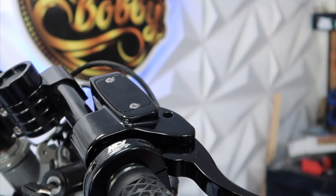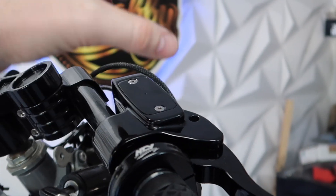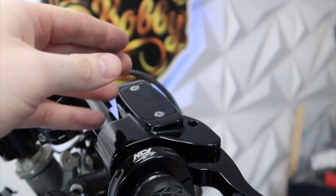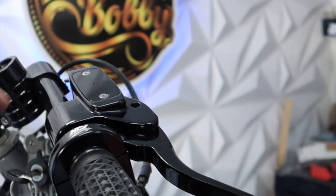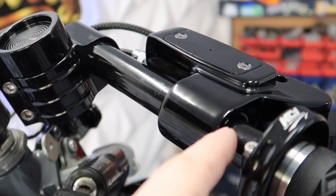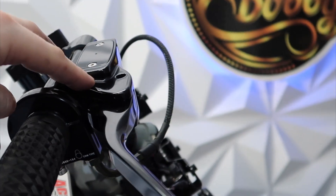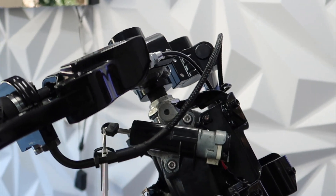If you look at all master cylinders - whether it's the Brembo, the Adelin, NCY, just everything - the master cylinder always sits up. As you know, even with the old round Adelin ones, you can knock it, get caught up on it, something can rub it. So I wanted something that was a flush master cylinder that wasn't raised up, and this is what I found. It is made for one inch bar, so I have a reducer on the inside. Everything is CNC - no plastic, no pot metal - everything is billet aluminum. It's not cheap, but it's super clean looking.